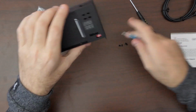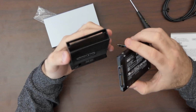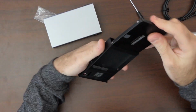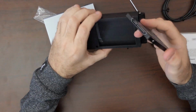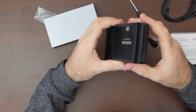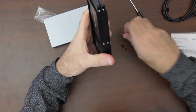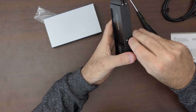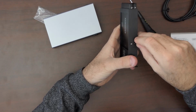That should do it. All right, so how difficult will this be? Let's take SSD number 1. Very plasticky little, it plugs in easy enough. Just remember, if you have data on any disks that you do this to, they will be wiped. Also remember that with this technology, you will automatically lose both drives' data probably if the thing crashes. So this is purely for performance, which is exactly what I want it for.